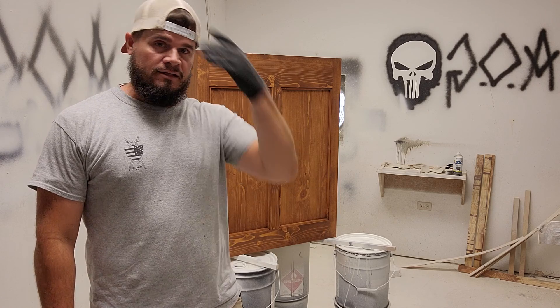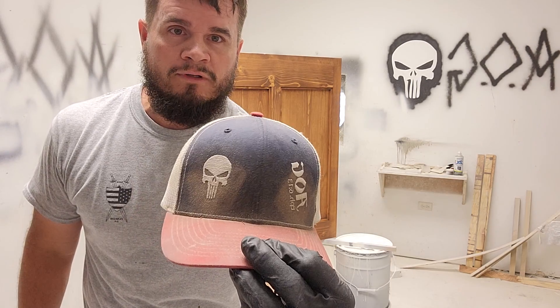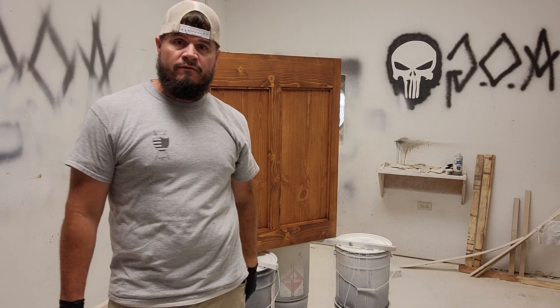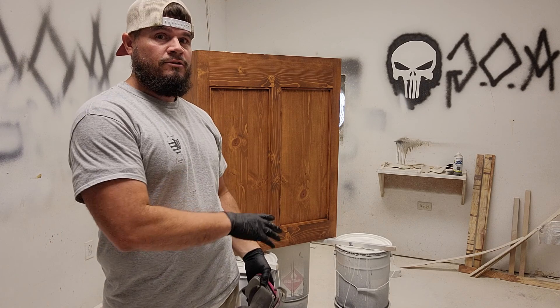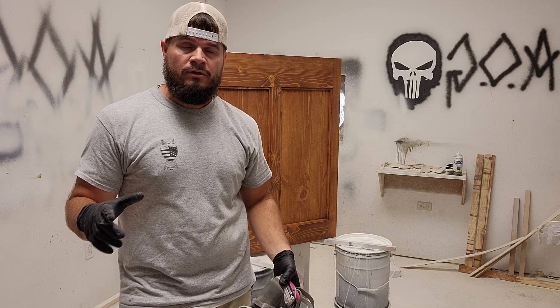It's still hot and sticky down here in South Georgia. We're sweating, we're hot, it's sticky, and we're getting pretty good rain showers almost every day. That means we're using a lot of lacquer thinner and a lot of retarder to slow this drying process down, because we don't want air bubbles and we don't want to have problems with blushing.